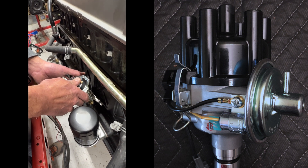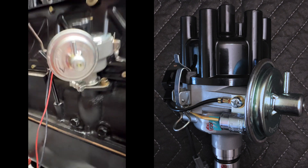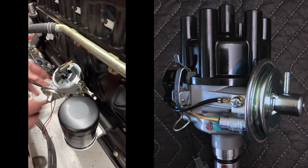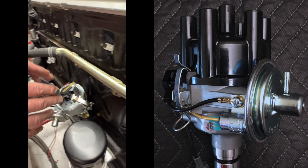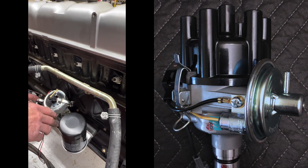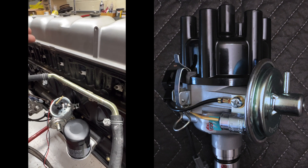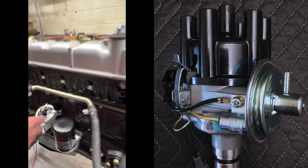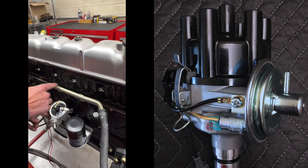We're going to find the gear. It didn't go all the way in — it feels like it's in, but it is not. That's all the way in. The thing will run — there's no question about it. However, this rotor is pointing about an inch and a half too far from where I want it. I want the body in the correct position while it's running when it's tuned after you fire it up and chase timing. So we're going to pull the distributor back out and turn the oil pump to the right just a little. I'm trying to get this rotor to point right where my finger is — the hump in front of number four. This is just where I like it.